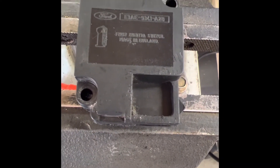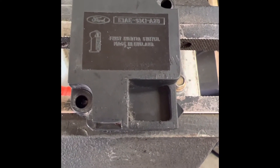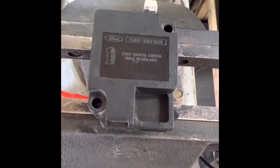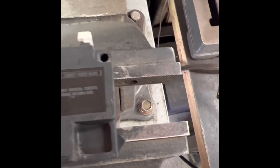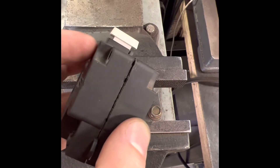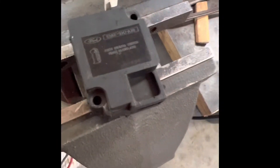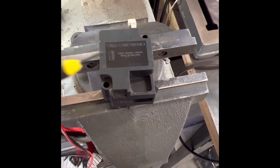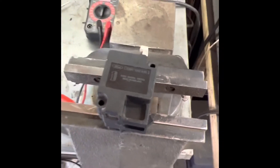I removed it from the car — it's located in the rear left, in front of the tail light, so pretty easy to get at. This is an unserviceable part, but if you try hard and believe in yourself, you can service it. I took a couple of dental picks and scored away at the edge, making a score mark all the way around. Then I used a couple of flathead screwdrivers and a small ball-peen hammer to work my way around the case, splitting it into two parts.